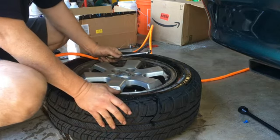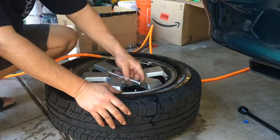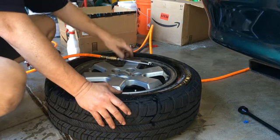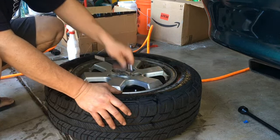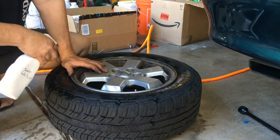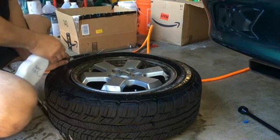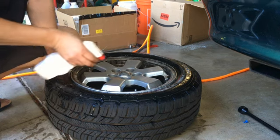There's that bang. I assume it's about 15 PSI — maybe 10. Yeah, 35. Compressor's off. Checking for air leaks — basically using the soapy water again, going around the edge and making sure there are no bubbles coming out. Focus a lot on the valve stem area.